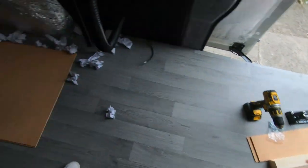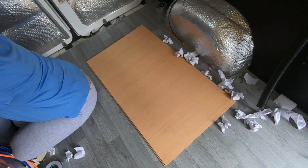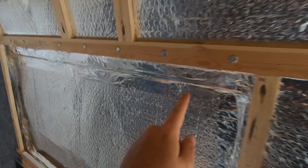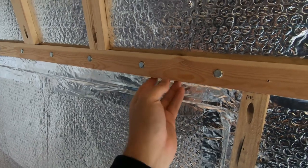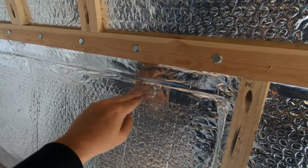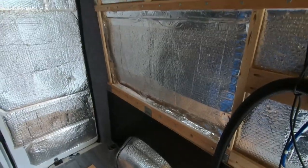We've got six mil ply, and I've cut them out to be perfectly 108 by 63 centimetres — so 108 centimetres along and 63 up. If you look here, that's the metal of the van. In hindsight we should have had thicker wood here, but never mind. We're going to start the recess from about here so it's not going to interfere with the metal of the van. We'll just crack on with this and show you in a sec.